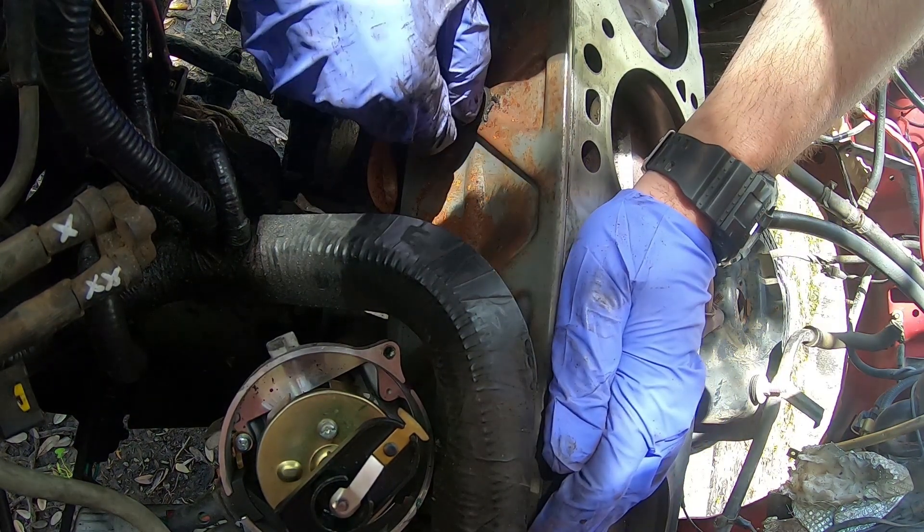Let's get to this guy somehow. They say do this, do that — I'm going to bend it out of the way. Move up one right here. The last one will be underneath this bracket. With those all free, with all those bolts free and all the brackets out of the way — there it is. It's still really clean. We're going to have to clean up in here because I got some debris on the lifters. And what you get is these grommets that come with this cork gasket — that's what we're going to replace today. Okay, so we got this off.